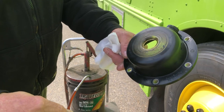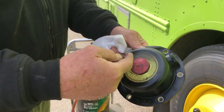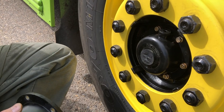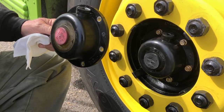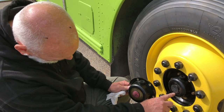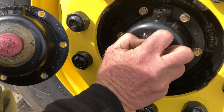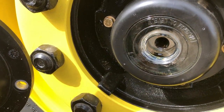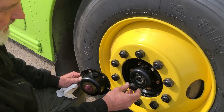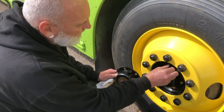This little cap is removable — I'm not entirely sure why, but this is the older style. Now I've got the new one on here, which was not super complicated, but you did have to have a little bit of mechanical skill because you had to scrape off the old gasket carefully, and these have to be torqued down. Now you can see the oil level down here. Like the old one, this will just pop out too — that's your ball bearings and races for the front wheel. That's where they go in and adjust it, and it runs wet in this fluid.